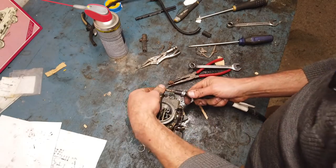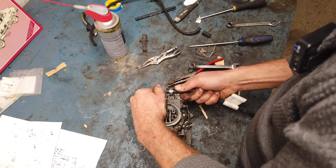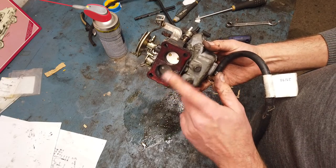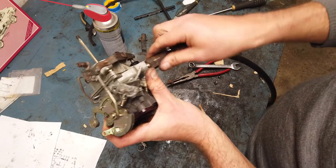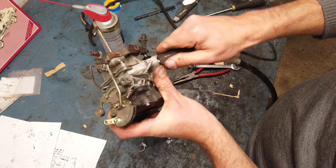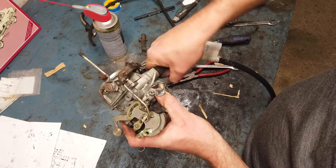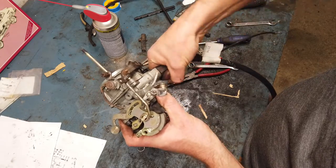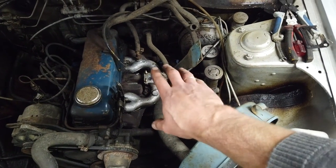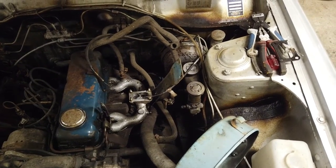And then a piece of fresh fuel line. Now I'm just gonna cut a gasket for the bottom end because I forgot that, and then put it all back to the car, and then take you back when I have done that. And then it's time to see if this makes any kind of difference, which I'm pretty sure it's going to do. I also did a bit of cleaning down here before putting on the carb, because it's possible to reach right now. Be back in a second.